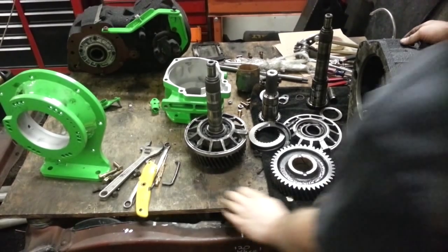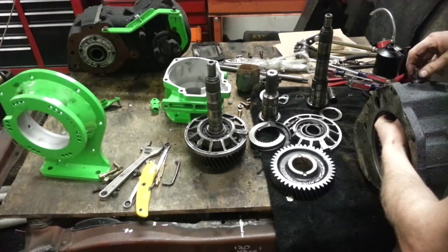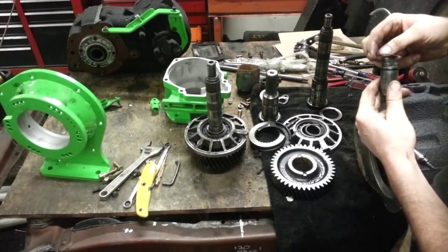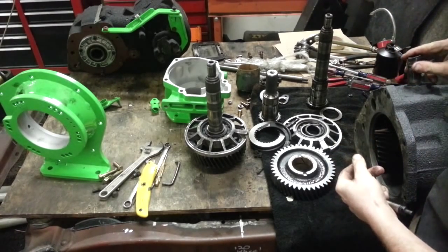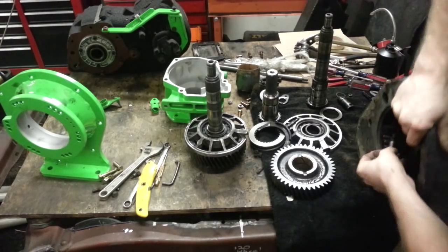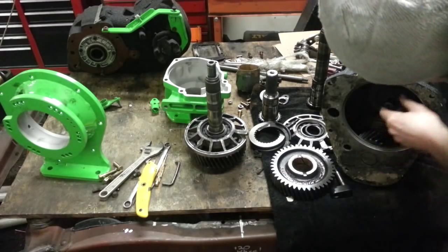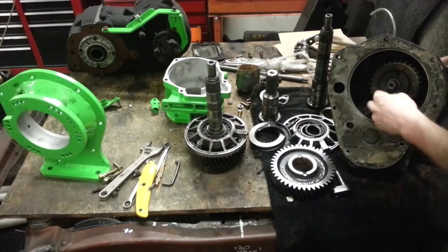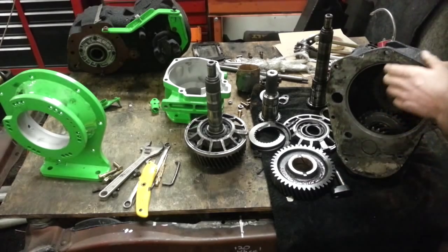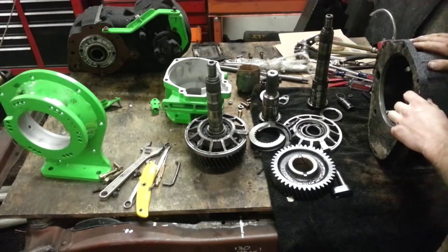Once you get all of that out, on this far side, once you take the nut out there's a snap ring that resides on this little part that was on the shift fork. Take that out and you can give it a push into the inside of the transfer case. One thing that helped getting that cam out was there are two notches on either side — give that notch a little rotate as you're pulling it out, because they're very close to each other, and that'll allow you to take the cam out of the 203 transfer case.